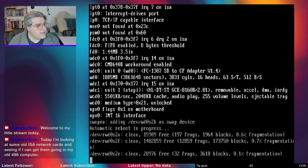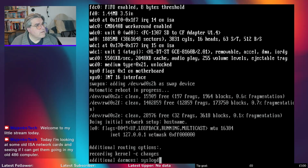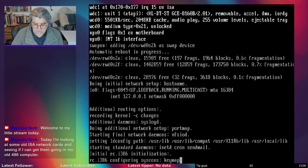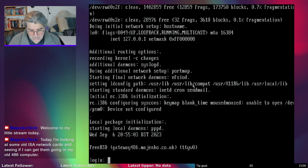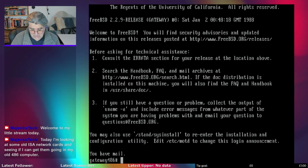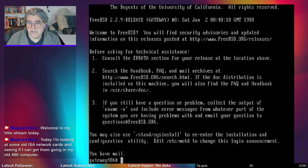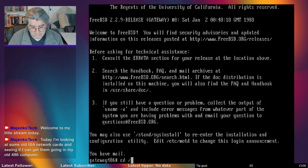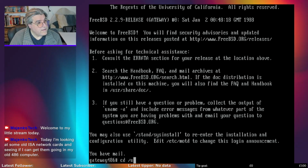Yes, that Realtek card. I mentioned that it worked on an 8-bit socket, or it looked like it was going to work on an 8-bit socket if I adjusted the interrupt suitably. I've got, hopefully, tomorrow, coming a nice new toy. I won't tell you too much about it, but it has 8-bit slots in it, and it would be nice to have a network card.